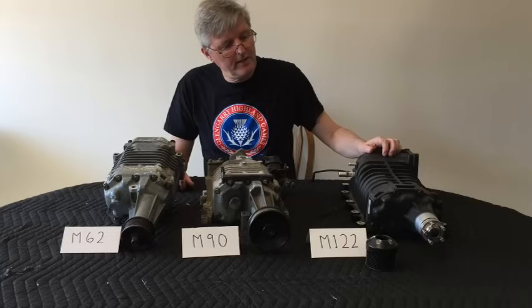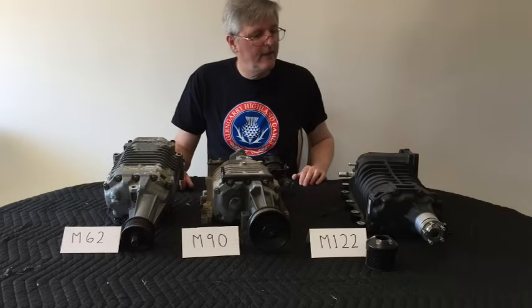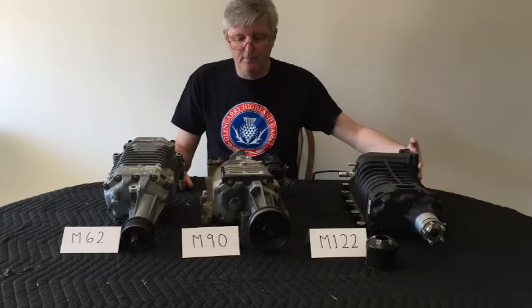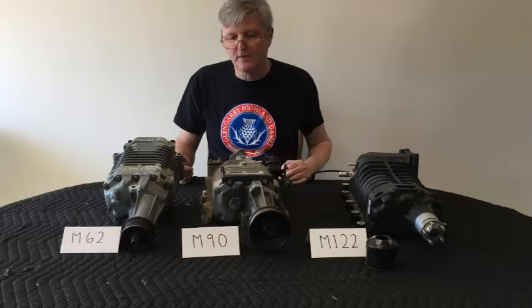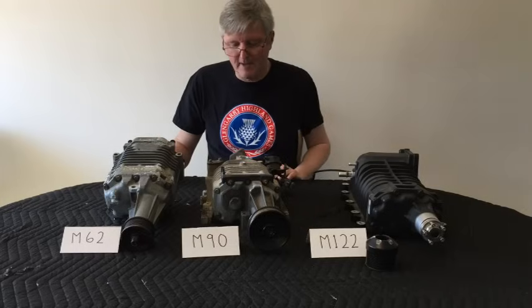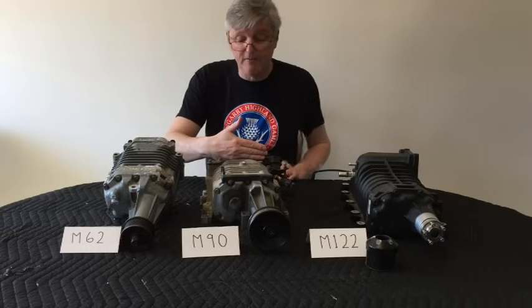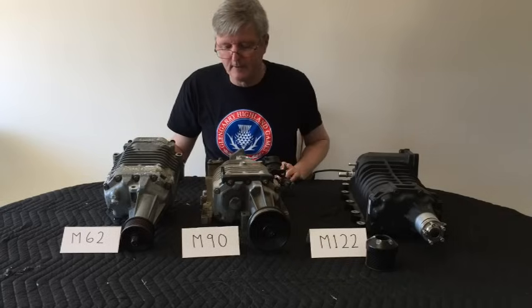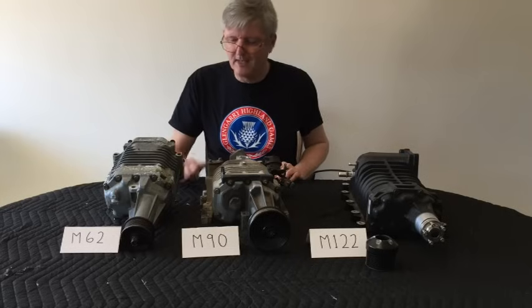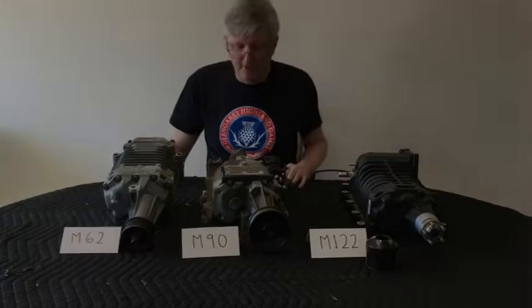The one off the Mustang GT500 I paid $450 for, which I thought was reasonable. What I like about this one is the orientation of the intake into the supercharger — it's a very convenient spot on a V8 or Crown Vic. The M90, not so convenient: it comes straight out the back, because on the Buick the engine is mounted transversely and they had more room to make it work that way. That's why I ended up cutting the supercharger off right at that point and attaching an elbow — actually the upper manifold elbow — JB welded right on there with lots of JB weld. It's been no problem at all. I wouldn't recommend welding on one of these units though; it's a big heavy casting and I'd be concerned about warping it, at which point it's junk. The JB weld has worked great.